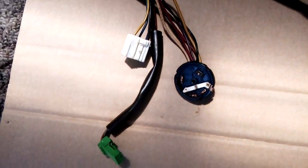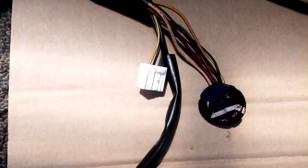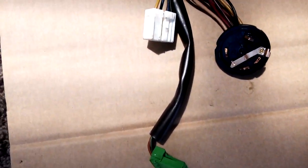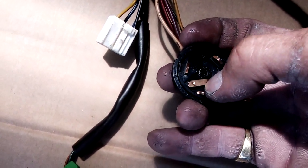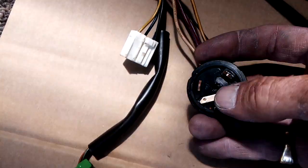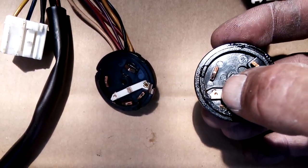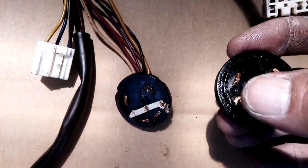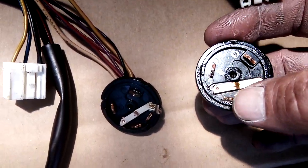I thought I'd best pull the plastic bit off the lock again and have a bit of a look. Lucky I've got another Fairlane sitting there that I could use for spare parts, so I pulled it out. This is what the old one looks like — you can sort of see where it's been arcing across just in that area there. That component is sitting up a little bit high. When you look at what they're supposed to look like, it's got a little plastic locator there to stop that arm from making contact with the brass or copper plate for the ignition system.